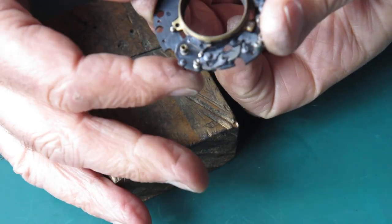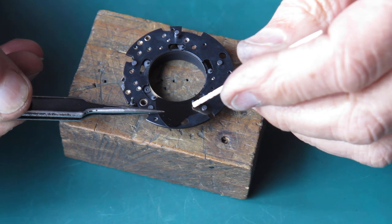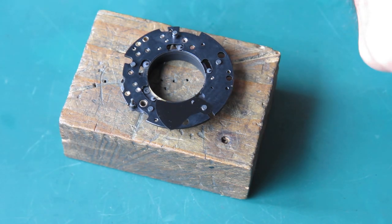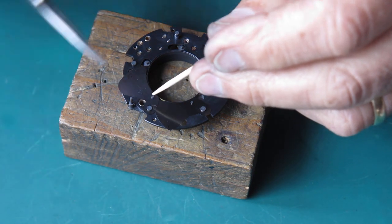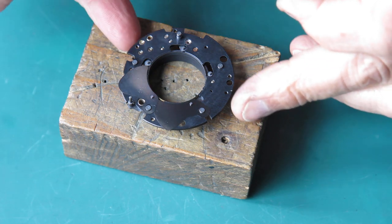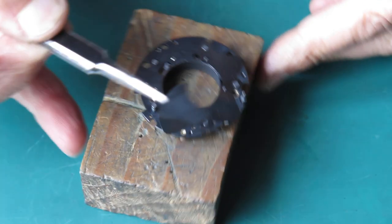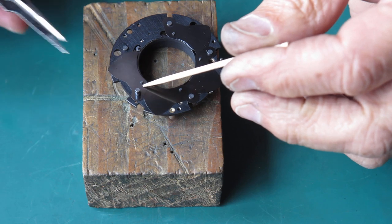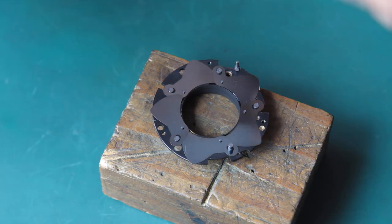Just check — put this into the blade open position and start stacking my shutter blades. There are six blades; four of the blades are identical. One of the identical blades goes in the first position. The second blade has a steep cutout in the back of the blade to clear that hole. The third blade is identical to the first. The fourth blade is identical to the first and third. The fifth, identical again.